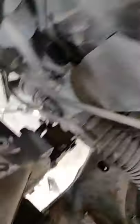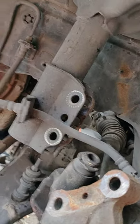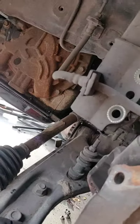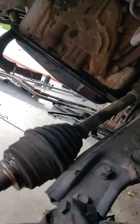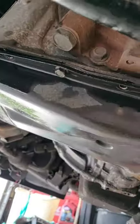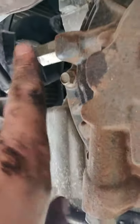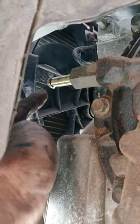I had to take the lower strut bolts out to be able to tip the rotor and hub back to get the axle out. I'm going to drop the transmission with the axles in it, and once I get it out I'll pop those axles out - just easier to deal with it out from under the car. Took the bolts out of the pan to drain the fluid. Also got a couple transmission cooler lines disconnected - one connects right here and the other is back up in there, but you can get it from up top.